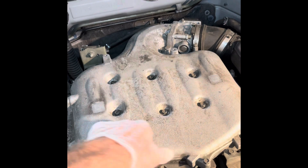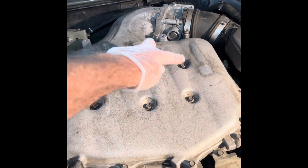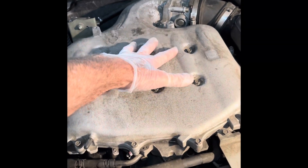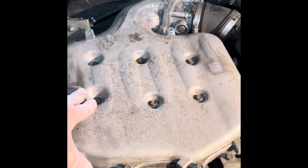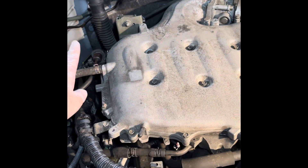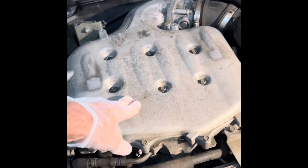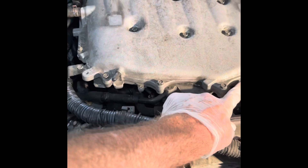Including the air intake, there are some hoses on the back. These top screws are different sizes — take note: the front screws are shorter than the back screws, and the screw in the very back is even longer, or about the same as the back three. Just keep note so you put it back together the same way. There are hoses that connect on all sides, and a hose in the back that connects to the intake. Clamps are going to need to come off.